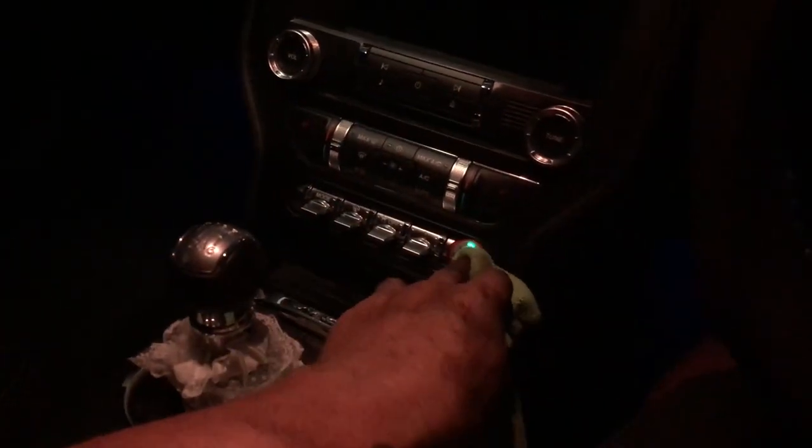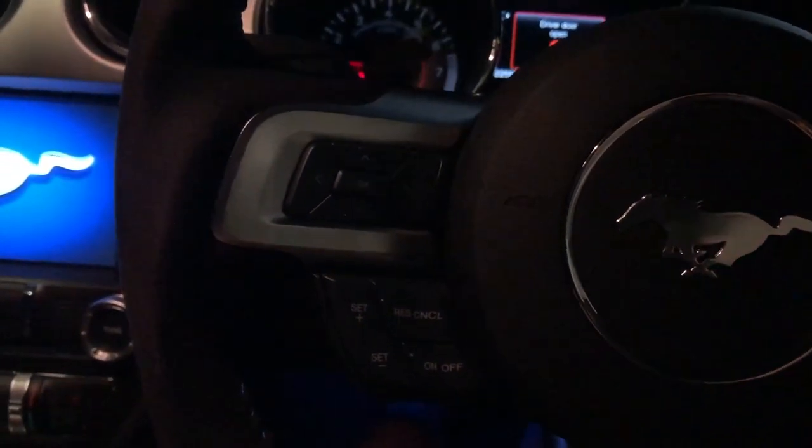Let's jump in. Let's make sure we've got pad pressure. Got pad pressure - happy days. So there we go, front brake pads installed on my 2017 Mustang GT. Not too difficult, a little bit messy, but otherwise pretty straightforward really. I pumped the pedal as well to make sure the pistons go against the pads nice and evenly, and they're ready for action.